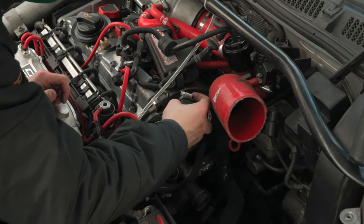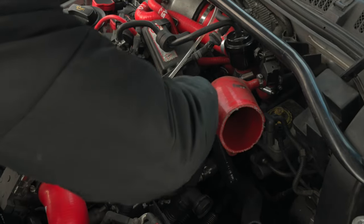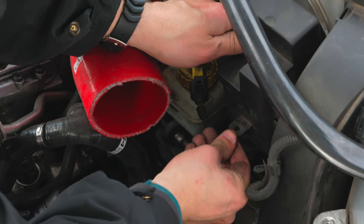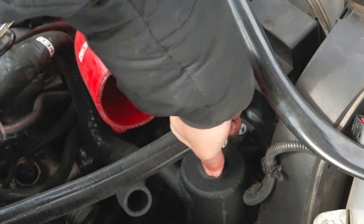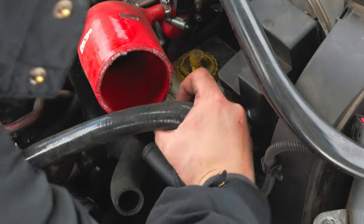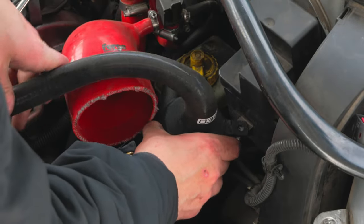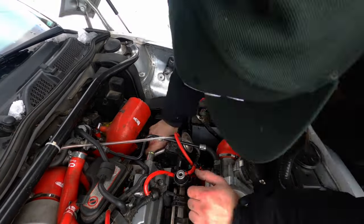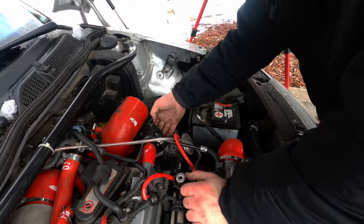Since the kit was designed for a 1.8, the main benefit is it has a triple exit hose designed to go to a catch can, so connecting the valve cover, the PCV, and the intake won't be the issue. The issue is where that hose is routed doesn't make any sense for this car, given how the tip is in a completely different spot than the other 1.8T variants. A good long while of testing was really playing with different hose combinations and routing to see what would actually work.